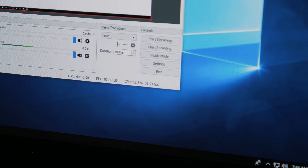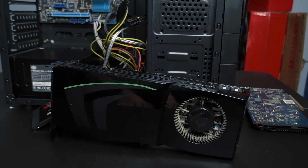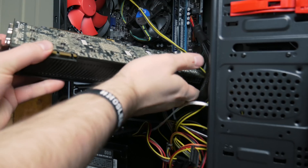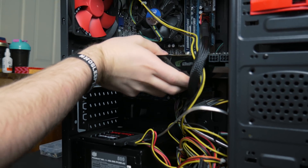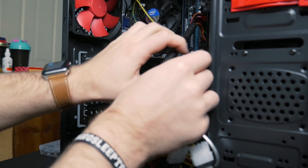If you stream at 30fps — while it is an option, I highly wouldn't recommend it in today's day and age of YouTube and Twitch. You can still get a constant 30fps experience with a secondary streaming PC, but even if your internet is really limited and you can only stream at 720p at 30fps, you could easily grab an office PC with something like Sandy Bridge or Ivy Bridge and make something that performs very well. But I wanted to step it up a little bit, so I decided to throw in a super cheap GPU for some hardware acceleration to see if I could get close to keeping that 1080p 60fps stream for under $200.